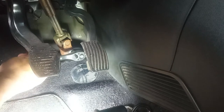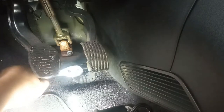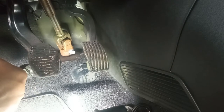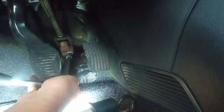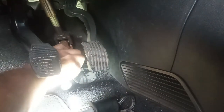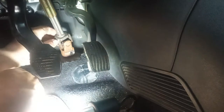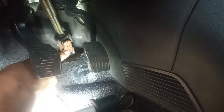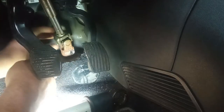If you need to move the steering wheel you can use an extension, but after removing the bolt and before pushing up the shaft, you have to put the steering wheel back in the straightest position. Now my steering wheel is straight and I can pull up the shaft. Most modern cars have a special keyway that stops you from putting this in any other position than the correct one, but just to be safe, let's treat it as an infinite adjustment — the shaft being telescopic, you can pull it up.